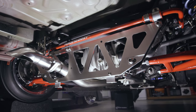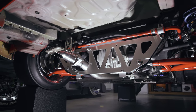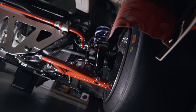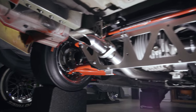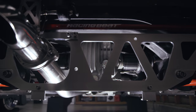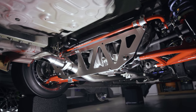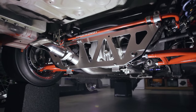That's about it. If you have any questions on how to do certain things for this swap, comment below and I'll usually answer within a few hours. Is this easier than the proper way — dropping the diff, removing suspension arms? I honestly can't say, but the proper OE way takes a lot longer. For me, dropping the diff and hammering out the old bushing was way easier. If you buy the kit from Miata Roadster, everything's provided — new bolts, new plates — so you don't need to burn off the old rubber. That's pretty much it for today.